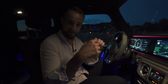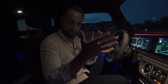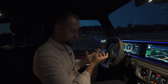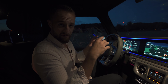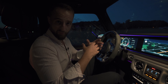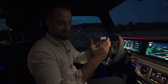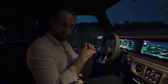You can then press the second button to fully lock the rear axle — 100 percent — so the rear wheels rotate at the same RPM left and right with no difference at all. You can also lock your front wheels fully with the third button, giving you the possibility to lock all wheels so they all rotate at the same speed — useful for getting out of sand for example. The compromise is the steering wheel turning radius is reduced.